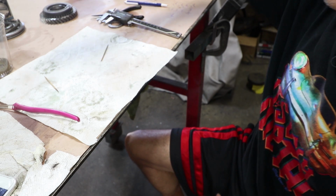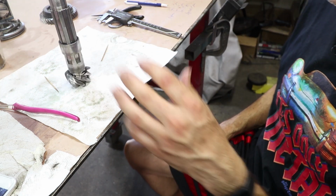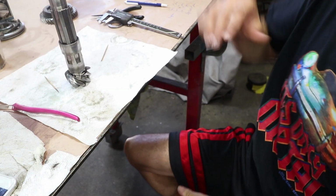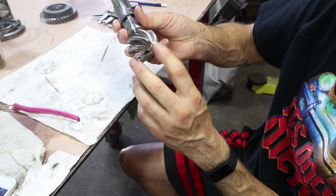This guy here, and then out of here, replace the rollers on the entire bearing. I'll replace all of them together. So I'm gonna start by putting the new bearing on the pinion shaft, because I know that the shaft is fine. The teeth on this gear are in great shape. There's no pitting or galling at all on this gear.